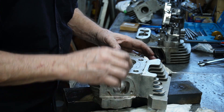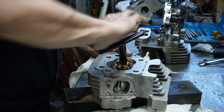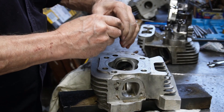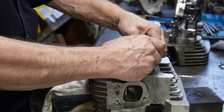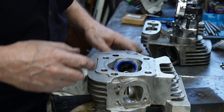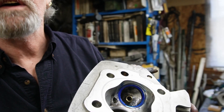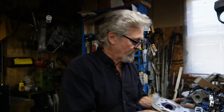Let's take a little bit of 30 off the top and see where we're at. Put a little bit of machinist blue. So we're trying to cut them down evenly and very carefully because that's the one that had been beat around so bad. I'm quite happy with the way it's turning out. I am getting a 45 degree cut all the way around and I am getting a 30. The 60 is going to have to be cut out of it because I have a wide 45 degree angle on the far side. We've taken a little bit of machinist blue and just covered our valve seat in it, letting it dry, and then I'm going to take a light cut with my 60 degree on the bottom. Just to see which side we're working to and what it's going to leave me for my 45 degree because I don't want to take a whole lot off.